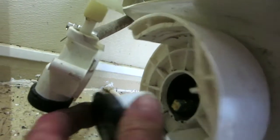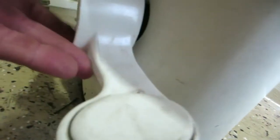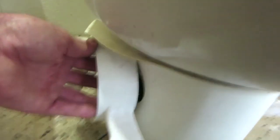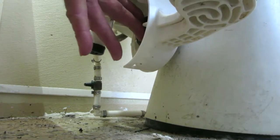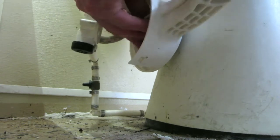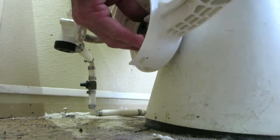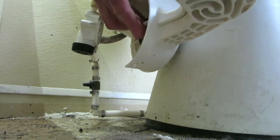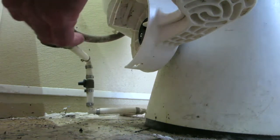The lever has to be in the correct position, and the spring cartridge has to be on that square shaft — both done together, with the cartridge on first. I'm manipulating the lever back and forth a little bit and pushing the spring cartridge in with my fingers. It's not easy to see, but I felt it pop in there. You can tell it's seated because it's somewhat pinned — it won't just flop around freely if it's in there correctly.